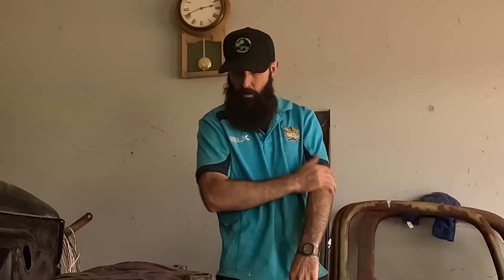Lost some hair on that one — I'll grow it back pretty quick! Oh man, that stinks. Okay, so it runs — that is so good, that is really exciting, I'm pretty happy about that. There's a bit of smoke, but I was using contact cleaner for electrical components as starting fluid, so that explains that. A few backfires there through the intake at the end — I'm sure it's just timing. I'm also missing a plug. I did have the cam sensor off and I think I may have moved one tooth when I put it back in, so that's probably why it's doing that.